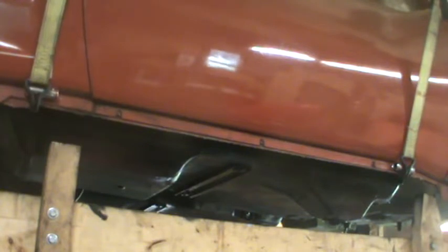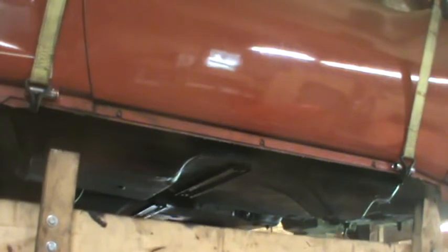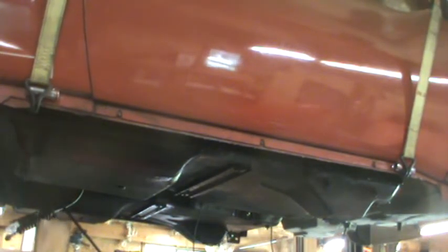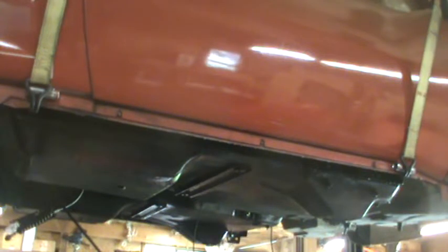So what I didn't mention in the lead-up video to this is that I am going to raise the lift back up again after I get the dolly out from under it and put some jack stands under where the body mounts are, because there were a couple of screws on the rocker panel covers that broke when I was taking them off, and I'm going to try to weld nuts on them and pick them out from the back side.